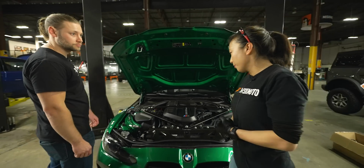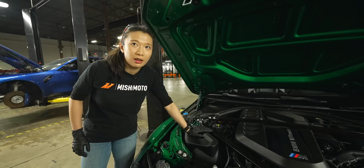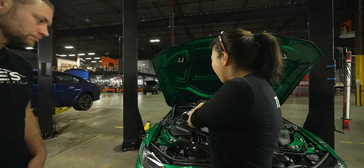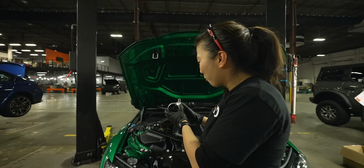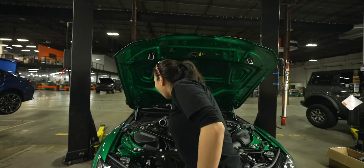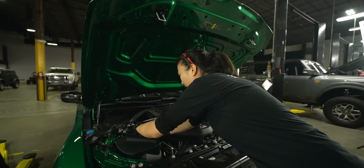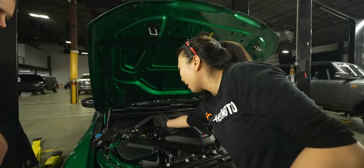Another thing that's very interesting about this vehicle, and we also did, is that we redesigned the turbo inlet on the passenger side. So the passenger side in stock one, let me grab it real quick. You can see it gives you the path to this turbo snout. We call it turbo snout. It goes onto the turbo, it comes straight out. If you try to adapt a conical funnel, there's simply not enough room in the engine bay to provide you with a smooth airflow path. So you almost have to jam the air funnel this way, and all these turns add to the restriction of the system. So what we did is we redesigned the turbo snout inlet.